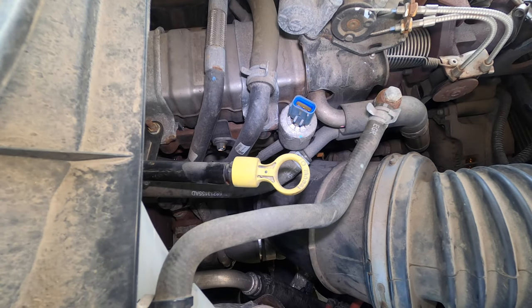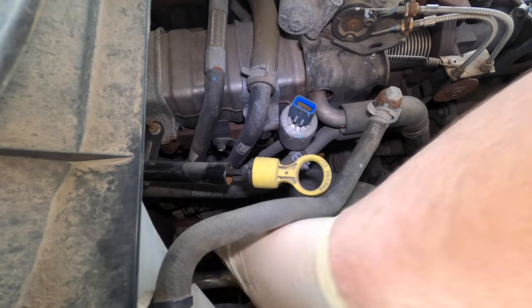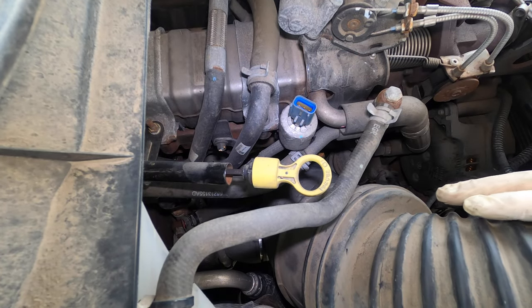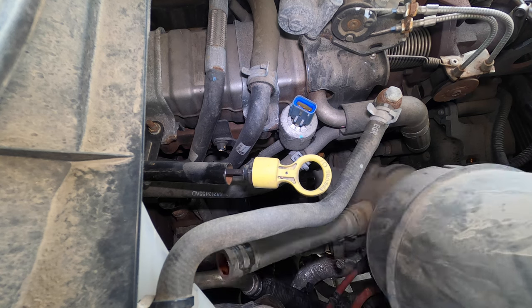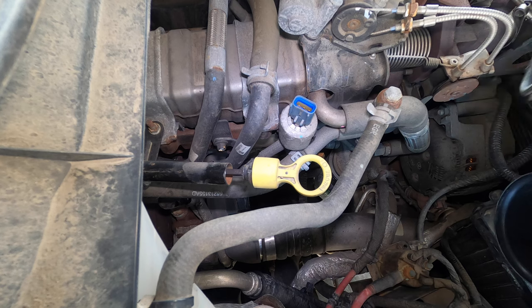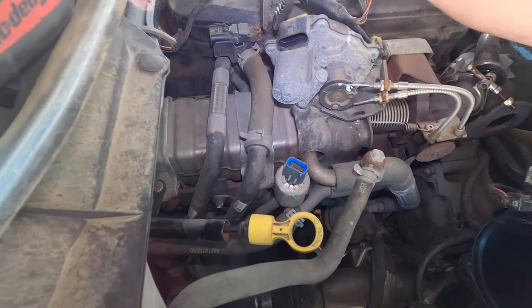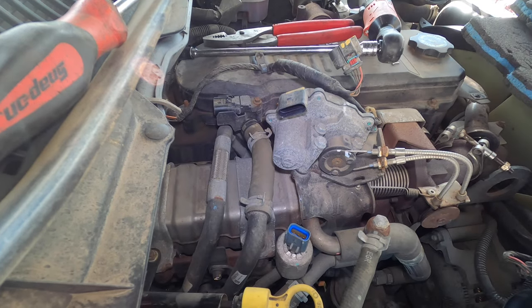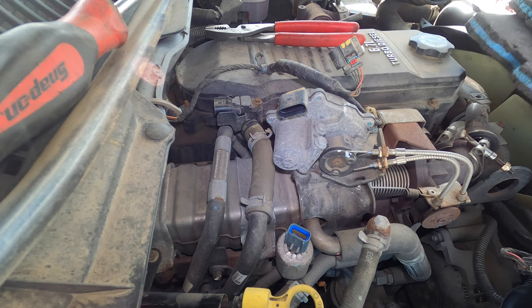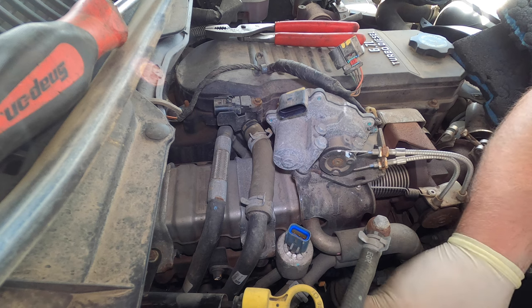Usually on these trucks you have a water pump leak, or the heater hose will leak, or the radiator - I've seen the radiators leak on these too. If you have no external leaks and you're towing and it doesn't spit coolant out of the reservoir overflow, then it's usually the cooler. If it does spit out of the overflow, it can still be the EGR cooler - I've had a couple trucks with a failed EGR cooler cause what I consider head gasket symptoms. Nowadays people think if there's no oil in the coolant the head gasket's fine, but that was maybe 50 years ago. With these high compression, direct-injected engines, they usually just put combustion pressure in the cooling system.